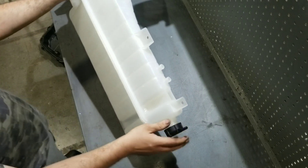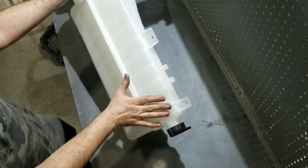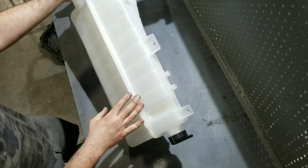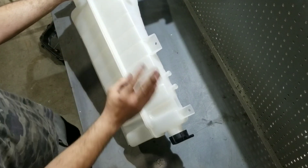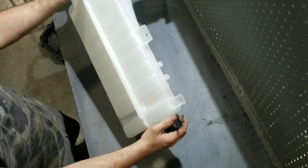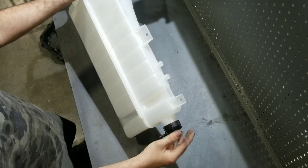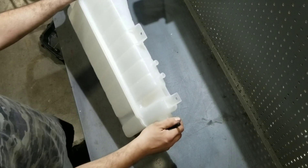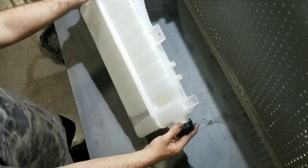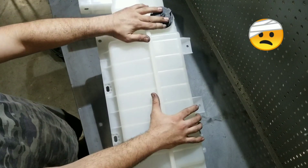With the pressure cap on this side, this side of the tank has mostly air — unless you have leaking cups, head gaskets, or excessive heat pushing coolant over. The point is, if you need to open or add coolant, you want to remove the pressure cap first when it's hot. Normally you don't want to remove any cap on a hot engine, but if you have to, remove the pressure cap first and slowly release the pressure. If you open the other side, you're going to get a face full of coolant.